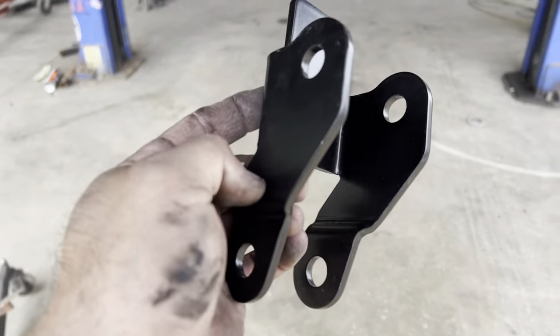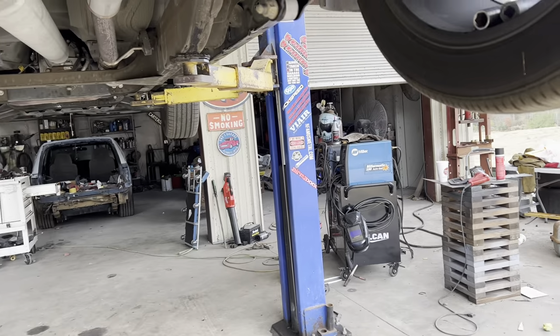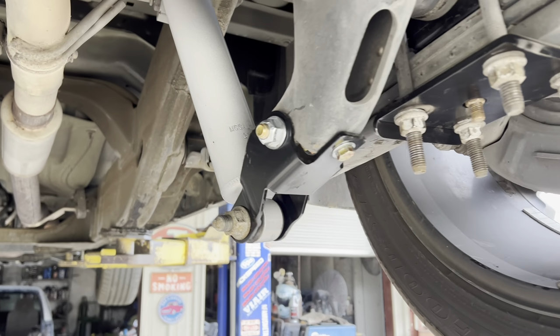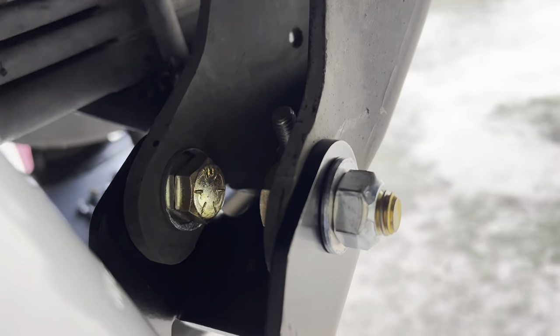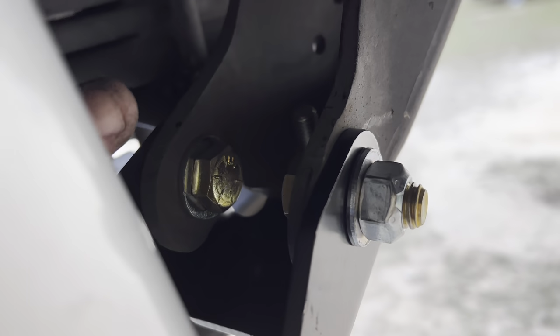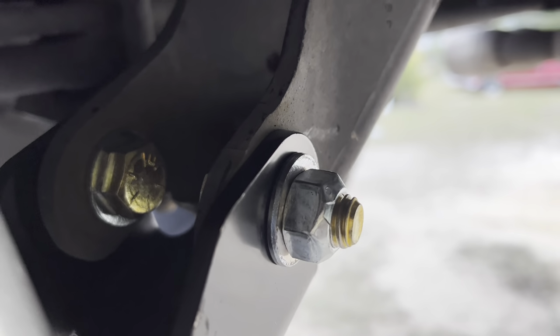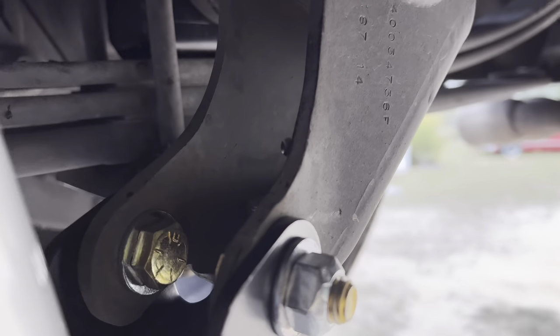So this kit comes with shock extenders. I didn't want to try to do it on the ground and show you and film it, so I waited till I picked the truck back up to put the bed bolts in. But it's pretty simple. It just slides over. Your factory bolt hole was here. If you look, they send two separate bolts, just bolts on each side. I always put the head on the inside, bolt out, because the end of the bolts touch each other if you run them through the inside.